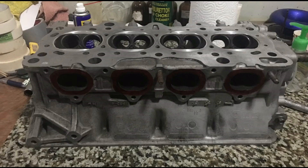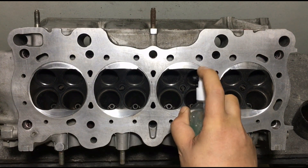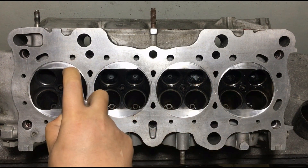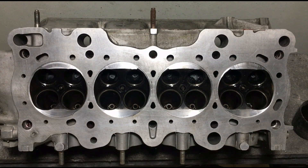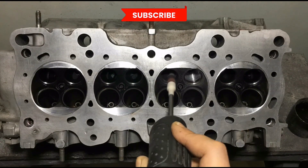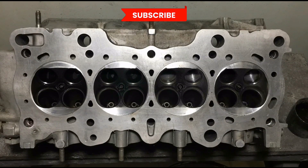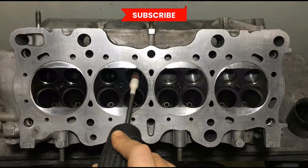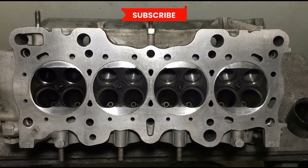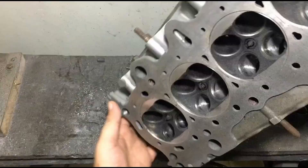Now let's go roughing up the exhaust ports. We use an alcohol mix with liquid soap — we spray some ahead of time before the cartridge roll, because we've tried WD-40 or even kerosene and it just smeared the carbon everywhere. We are using 80 grit right now just to get the initial shaping going. Almost done — you can use a rougher grit, but we actually prefer just 80 grit. Now we flip it and it's ready for the roof.